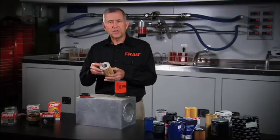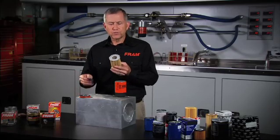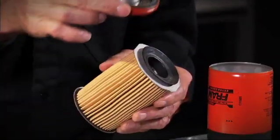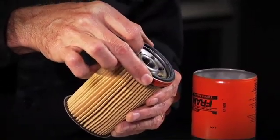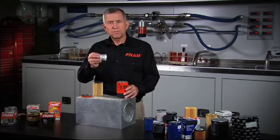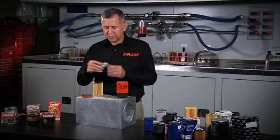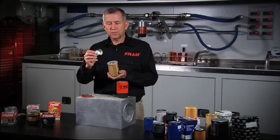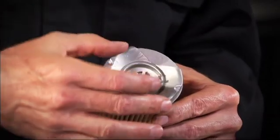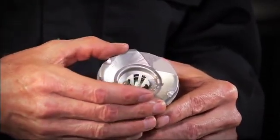The other good point about the fiber end disc is that they actually create their own seal. The anti-drain back fits inside the fiber end disc, and then the plate fits over that to give a good seal to the cartridge. Inside the filter, you have the retainer with the relief valve. The retainer, being metal, seals onto the end disc, and you can see an indentation on this filter where there's a very good seal between the end disc and the retainer.